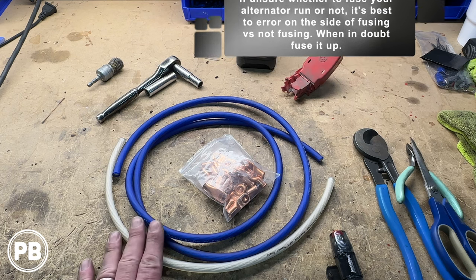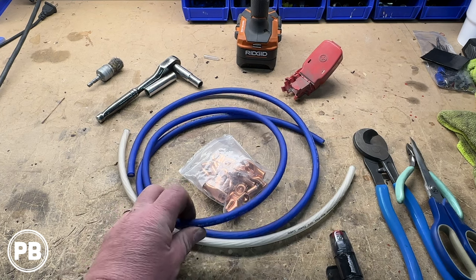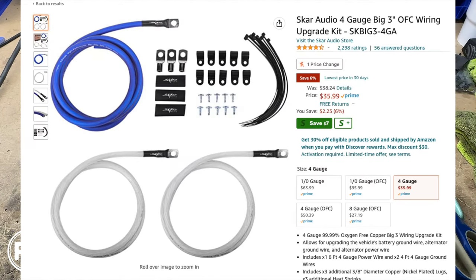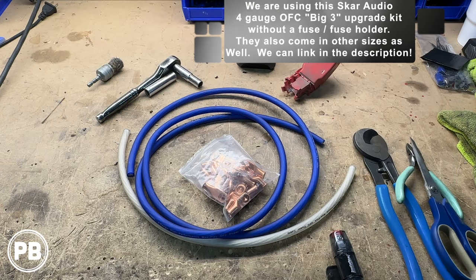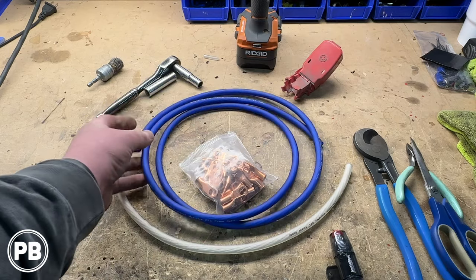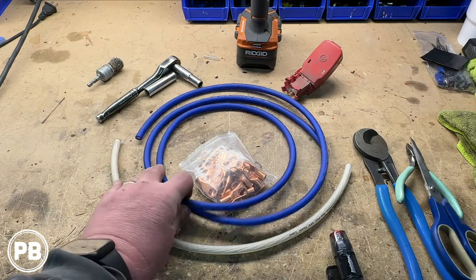So we have a kit here. This is some 4-gauge OFC wiring. We have some copper lugs. Again, most wiring big three upgrade kits will come with everything that you need: all the lugs, heat shrink, zip ties, split loom, everything in there, and we can link our favorite ones in the description. With this wire here, we have about 6 feet of wiring here of our positive wire.